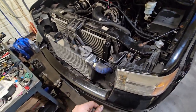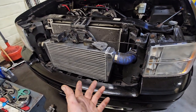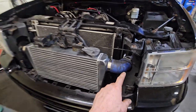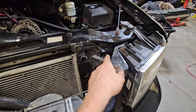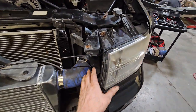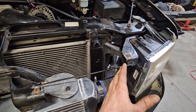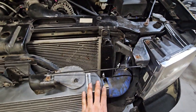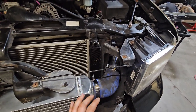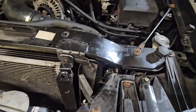I figured we can go over the cold side on this thing. I've been asked about routing on the cold side and it's just different from truck to truck. This one actually seems to have laid out pretty nice — there's plenty of room right through here between the radiator and the core support, and the headlights are nice and out of the way. So this was a nice path for the intercooler piping. Typically on the cat-eye trucks you've got plastics up in here that hold the headlight in, and I just don't like cutting that plastic because it's already weak and flimsy.